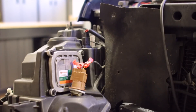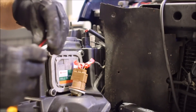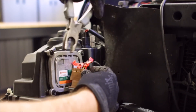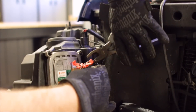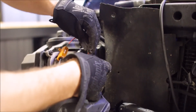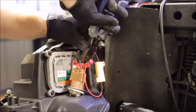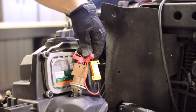Here's a closer view of how this resistor installs on the passenger side. We've got our two quick connectors on the two outside wires. Take the resistor and run it into the open space and just clamp it down. Then take the other side of the F150LEDs.com resistor, run it into the other quick connector, and clamp down the silver tab as well. And that's all there is to installing the F150LEDs.com front turn signal kit.